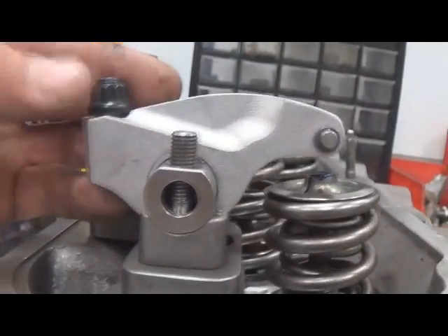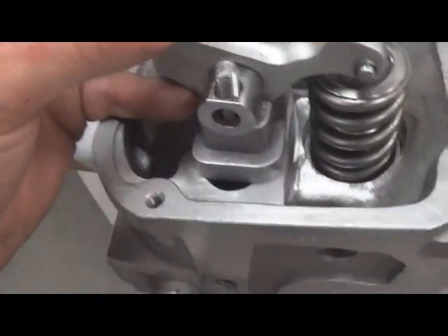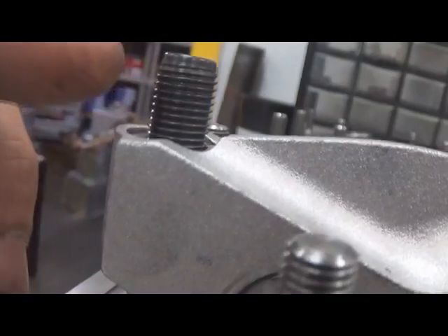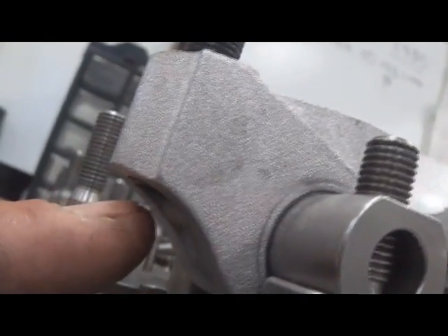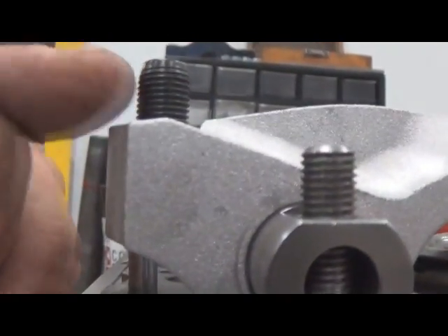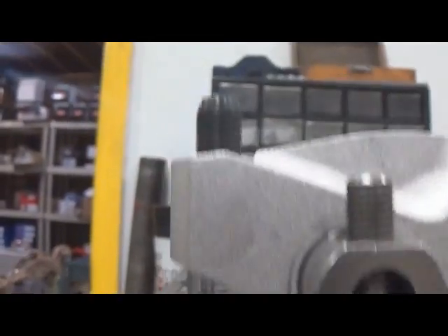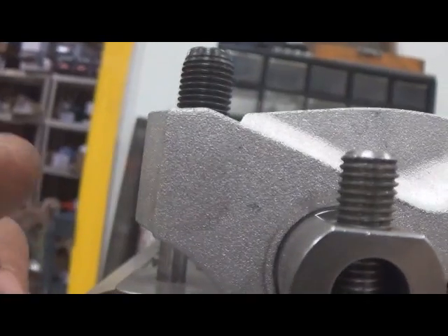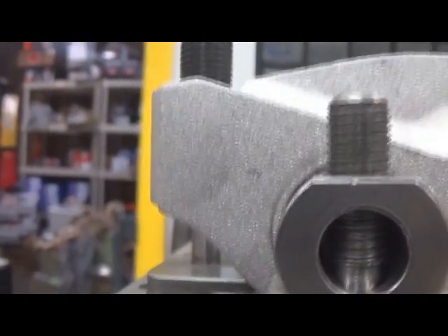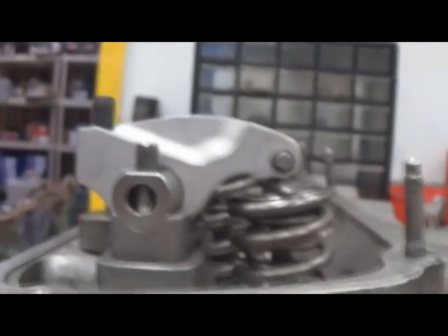To further elaborate — we have an adjuster here. If you have too short of a push rod, this adjuster inside the rocker is going to be too far out the bottom, and the chances of deflecting it are similar to having it too far up on a stud — you could deflect the push rod cup and possibly snap it off the bottom of the rocker. On the flip side, if it's way too long and you can't get enough adjustment, that can be a problem. Essentially, you want to seat this cup, then turn it one turn back down into the rocker arm as your standard starting point, then figure out your push rod length accordingly. Too short is a major problem; a little too long is not going to hurt you nearly as bad.